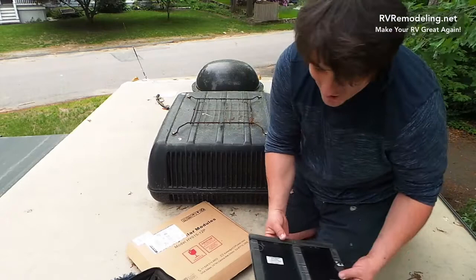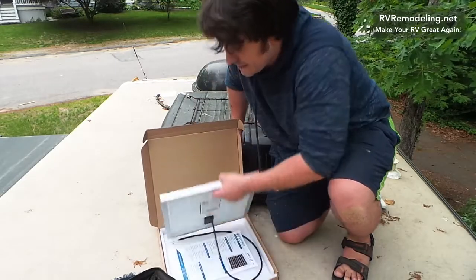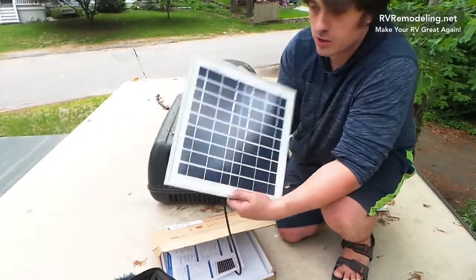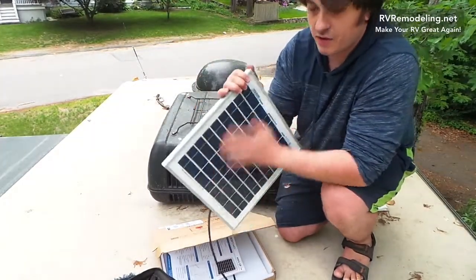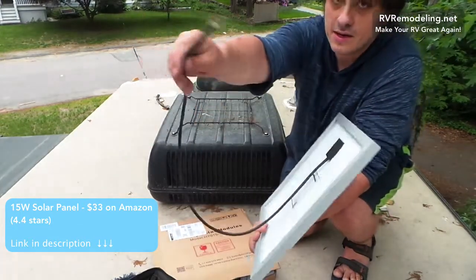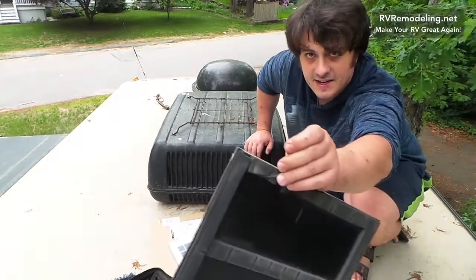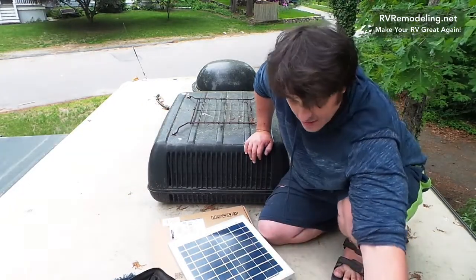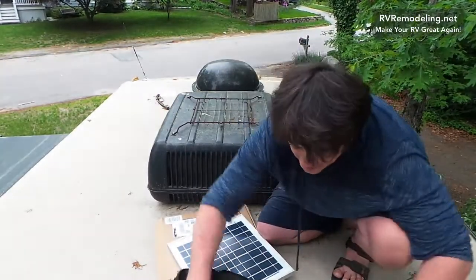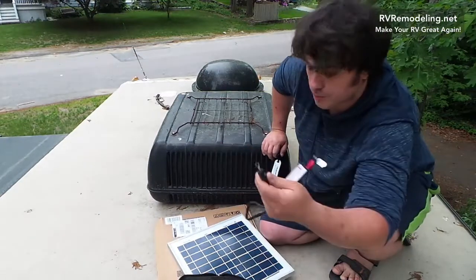Be careful not to scratch or cut your roof because this is bare glass. What I did is I got a 15-watt replacement panel, so now this one is just like a big panel that goes on your rooftop with a frame — it's not even glass I think — and it has this cable with just bare contacts. The old panel came with this SAE connector, which broke also, but I got a replacement wire-side SAE connector, so we can now hook up into our wiring.